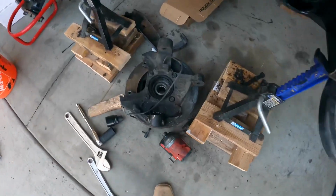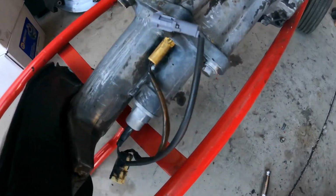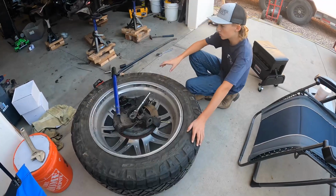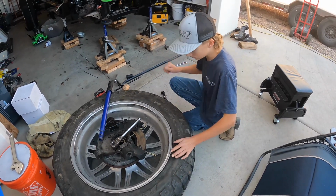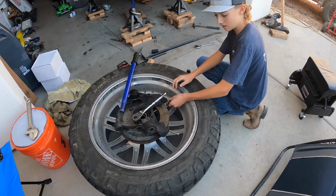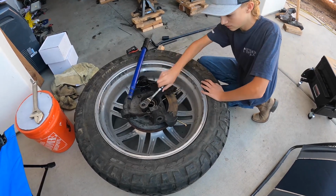So like I said, we got new wheel bearings for these and those white boxes. And then we got to address this leaky diff seal here. Okay, so we started doing these wheel bearings. They were on the ground and it was kind of hard for us to hold it and torque it off. So we rigged up these grade 8s in here in the caliper so then it will stop moving, and then we just threw it down in the rim so then we could get these out.